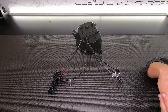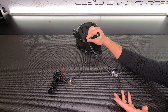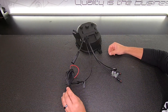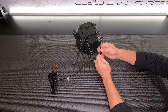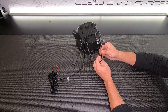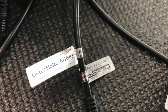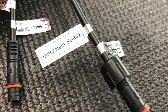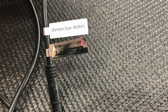From the back of the headlight we can identify our cables. This is the headlight high beam/low beam plug which goes right into the factory connector. This is our daytime running light connector, already tied into our DRL harness. Now we have three cables, each clearly marked — the tag identifies exactly what it goes to for easy identification. These three cables control our three different LED elements: the inner ring, the outer ring, and the demon eye.